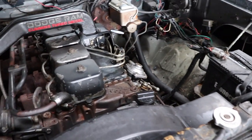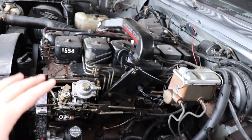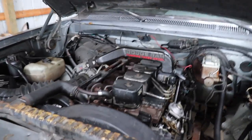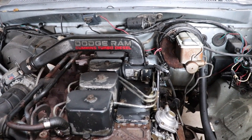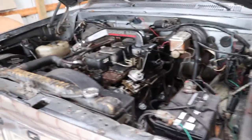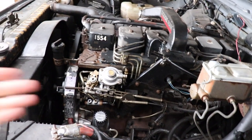We're going to be running bigger injectors. We'll need a lift pump — that probably won't be installed instantly. I'm going to build everything else first with the fuel and the engine, and then we'll probably baby the truck over to a shop to have them install the lift pump. They'll do it installed for about 700 bucks, and the pump itself is almost 700, so if they get a better deal and can install it cheaply within a day, I'll go that route to save money and time. We're going to do 60-pound valve springs, a 3,200 RPM governor spring, and we're going to keep the factory VE pump.